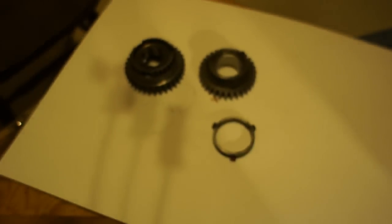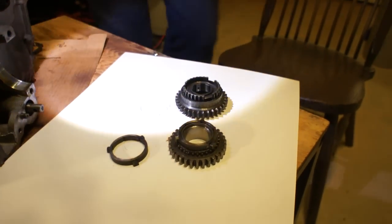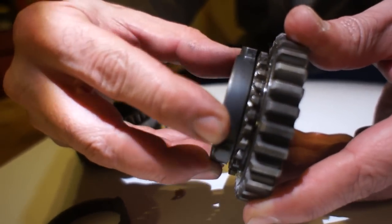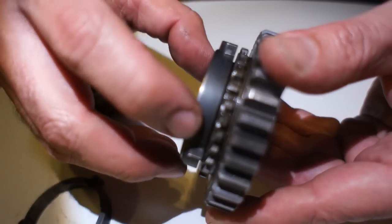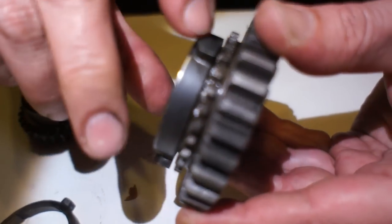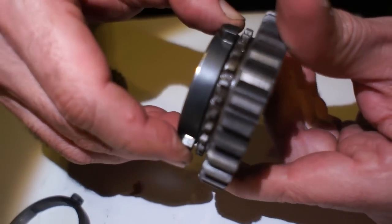I've got another set of gears here to show a sample. This is first gear, and we can see here's how the synchro is supposed to be — it comes up and you've got a gap here. The specification is somewhere around 10 to 30 thousandths, which is about where they start out new on most of these. When there's room here, it rides up on this cone and brings this gear up to speed really quickly.